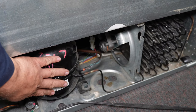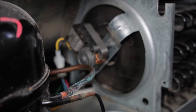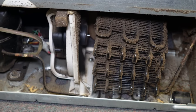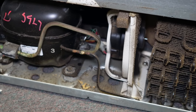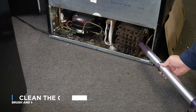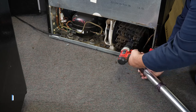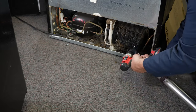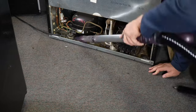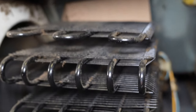If it isn't running, chances are you do not have a Freon problem — it's going to be a control thermostat or relay problem. Also make sure the condenser fan is running; it takes cooler air coming in through the cardboard or metal plate and blows it over the black coils and compressor, then out through the other side. If the fan isn't working right it won't allow the air to exchange, which is what makes the fridge cold. While inspecting all these things, make sure the black condenser coils are cleaned. Heavy coils like these can be cleaned with a coil brush on a handle or with a drill, as well as a vacuum cleaner. If yours has a thinner aluminum coil with thin metal heat sinks, use compressed air to blow the dirt off, then gather it up with a vacuum cleaner.